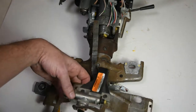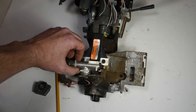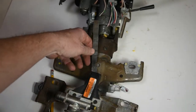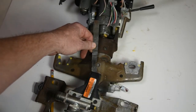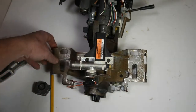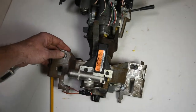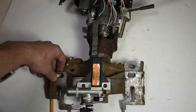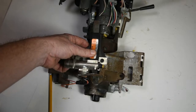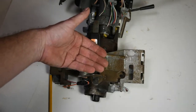So they came up with an adaptive steering column. They hooked into the airbag and put in a pyrotechnic device — just a little explosive device. They attached a strap to hold the steering wheel up where we want it so it won't come down. They attached the pyrotechnic device to it, made a frame, and bolted that to the aluminum pieces. So the strap is bolted to the frame and basically holds the steering column up in position so it can't slide out of those aluminum pieces until we're ready.